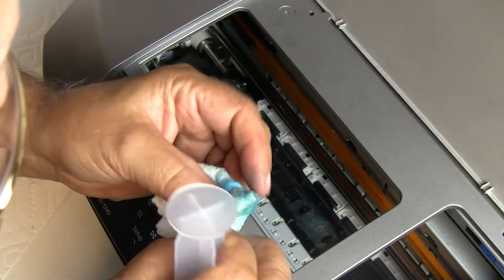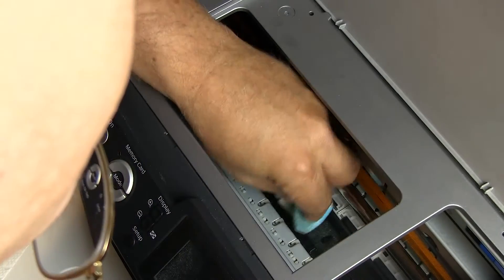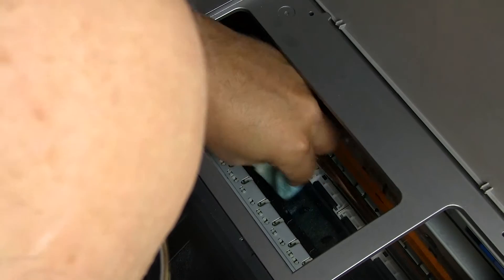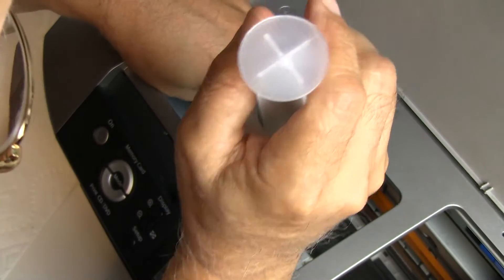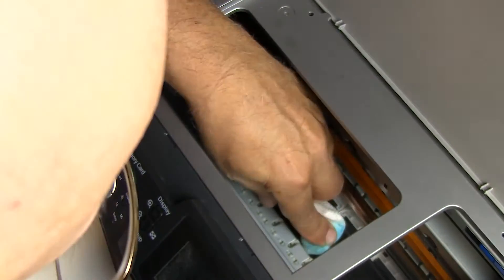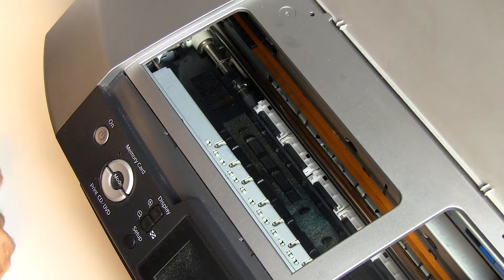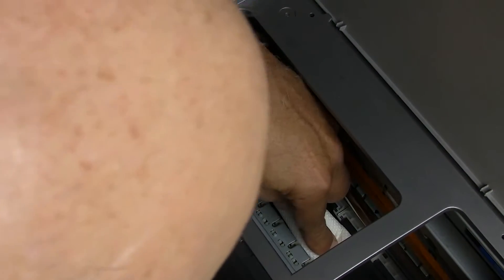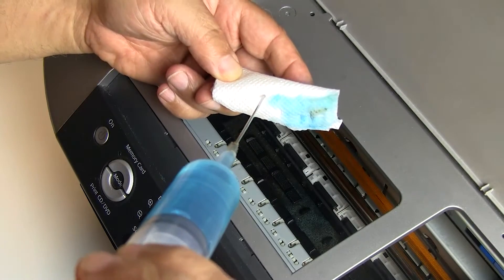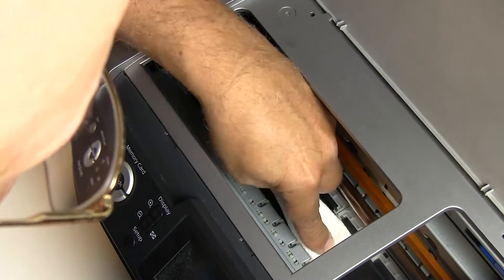This is actually not too bad, as a result of those soaks I was doing to clear the head of some stubborn clogs I had earlier. You would dab the complete platen sponge, treat it with Windex — pretty much soak it a little bit — then dab it off with clean paper towels. Repeat this over and over until you're fairly clean; in other words, until you're just getting Windex back. Any other color means there's still ink in those sponges.